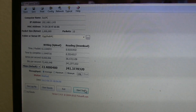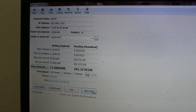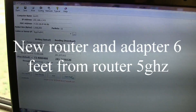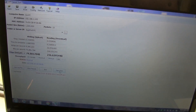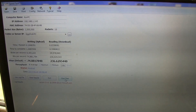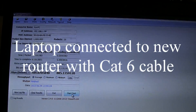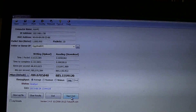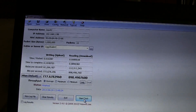From 60 feet with several walls away, I took the laptop over into the same room as the router — that's where most of those big numbers you see in online tests by the big companies show up. The numbers didn't speed up much when I moved closer. I think I might know why: I had turned on the Quality of Service feature of the router, which sorts things out and doesn't let any one device get too much bandwidth. I turned that back off — there should be no limiter now. That sped the writing up by quite a bit. I finally got some good numbers, but what it took was plugging in the ethernet cable and running the test directly to the router. With ethernet I see great results, but with several different ways of doing Wi-Fi I haven't been able to improve it much. I've disabled the antivirus, I've installed LAN Speed Test on another newer laptop and run that wirelessly — still getting the same kind of numbers.